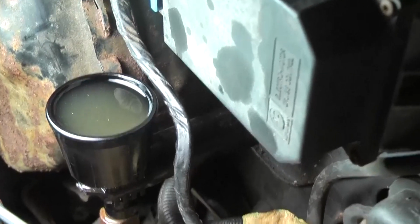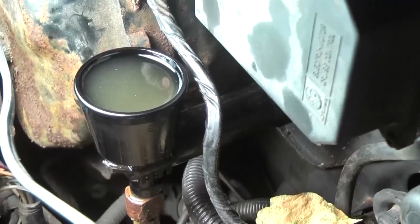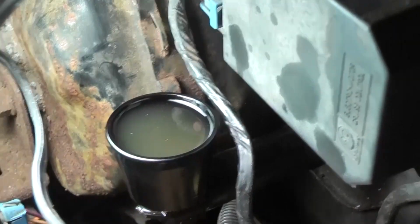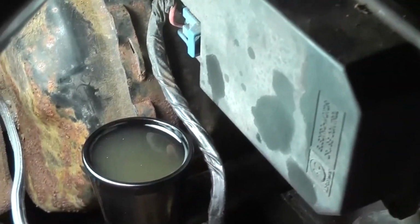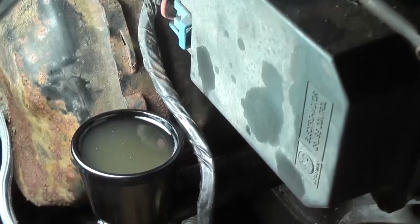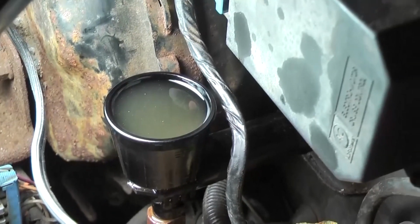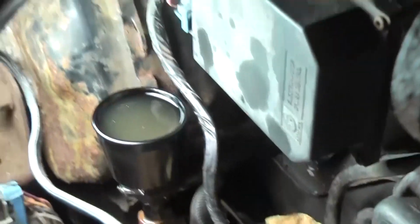and I think before too, I had the same problem. If it's binding, you're supposed to push it in first, then keep it pushed in, then slide it on the bolts really quick and try not to let it out until it's in there, because I think for some reason it doesn't seat properly if it's all the way forward, if the length of it is all out. So I think that's before, when I did this with the slave cylinder, I took it off and put it back on, and I had trouble with that too. So I'd just like to mention that.